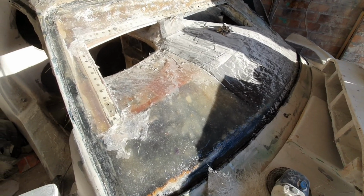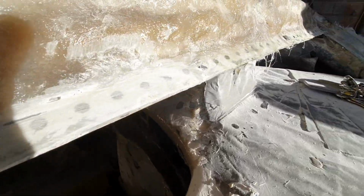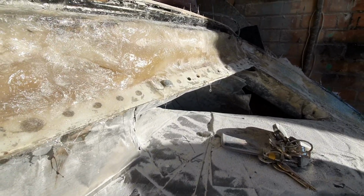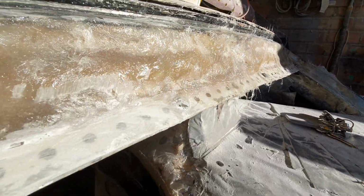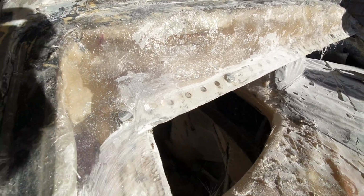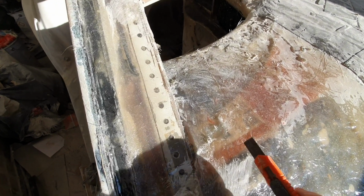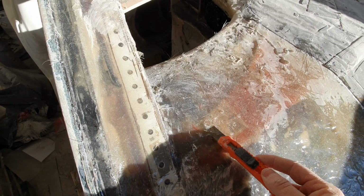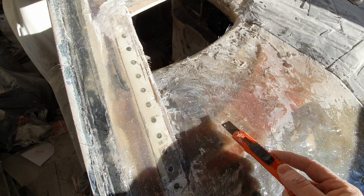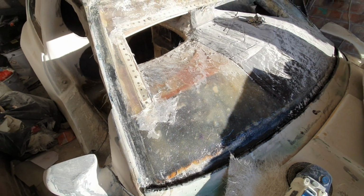I was sanding this back, so I was already starting, so I wasn't going to do a video for this first half to be honest, but I already started taking some of these rough edges off, see all these rough edges along there. I've started taking them all off around here, making it all smooth. I literally just started getting into it, no problem, all good. And then I realised some of the fiberglass resin mat hasn't gone off. It's still soft after, what, nearly a week. And I realised what I've done.